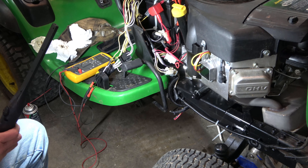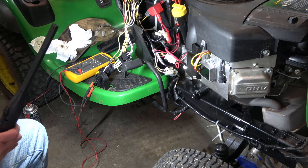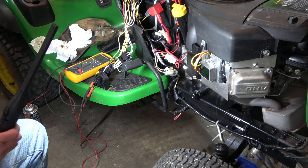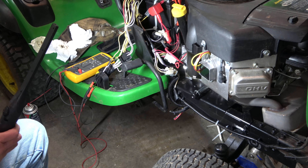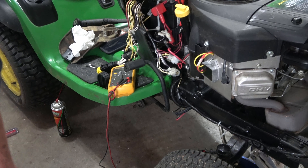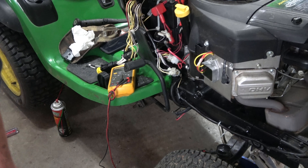Now I'm going to check the wire harness. It's wide open since the solenoid is not in circuit. I'm shorting the circuit with a couple of small screwdrivers as probes across the two units connected to the switch. I'm getting 1.9 ohms — so if the whole circuit was 2.2 ohms, the solenoid resistance down below would be less than 2 ohms.